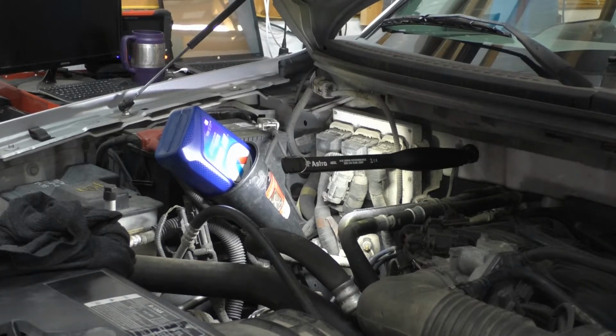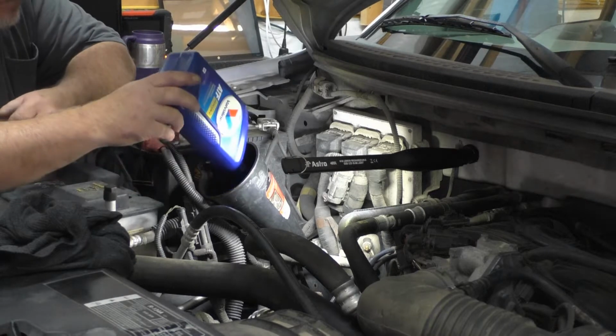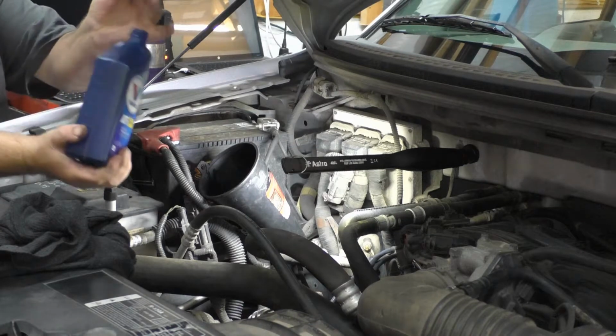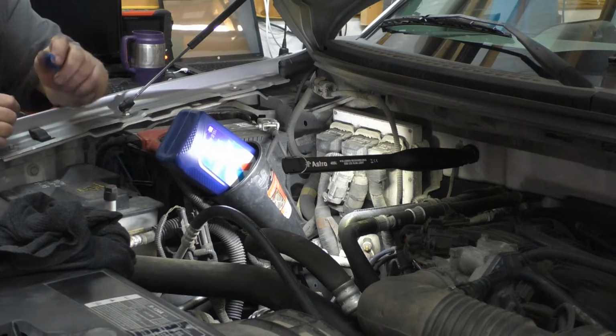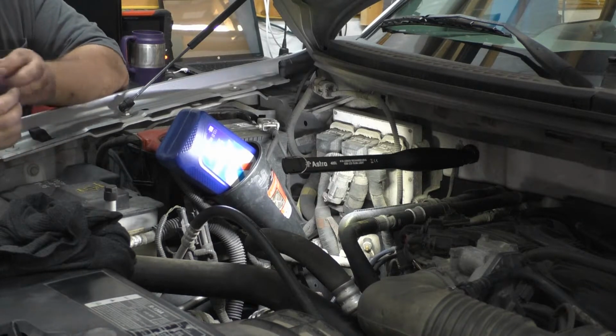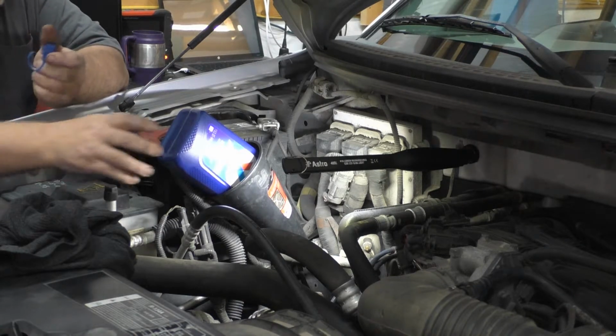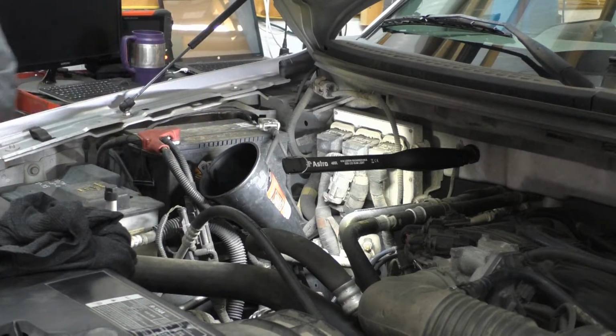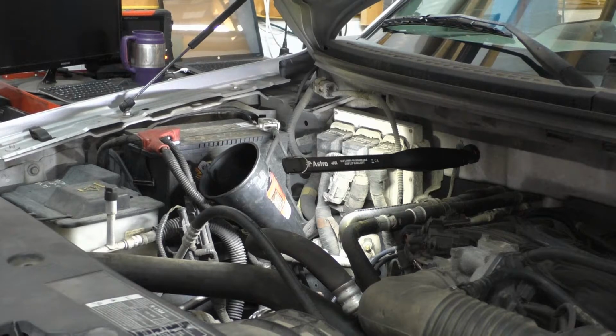We certainly got some rattling going on. Well, now I've got 10 quarts in the transmission. We may be a quart or two low. Shouldn't be no more than that, since the torque converter had transmission fluid already in it. Got some ticking going on up front. Hope that's what it is anyway.